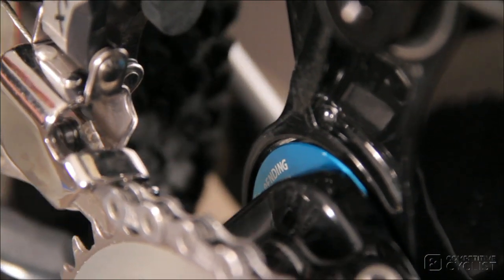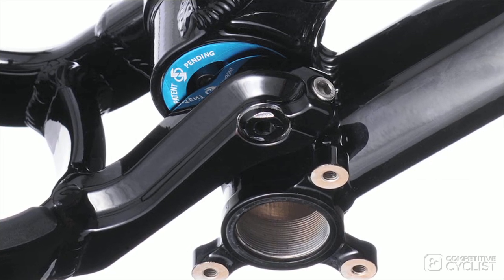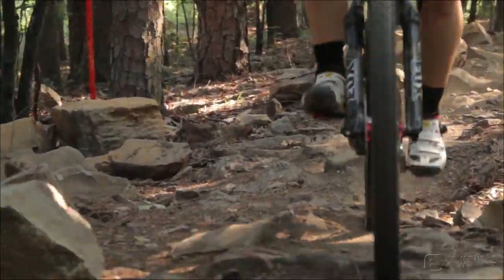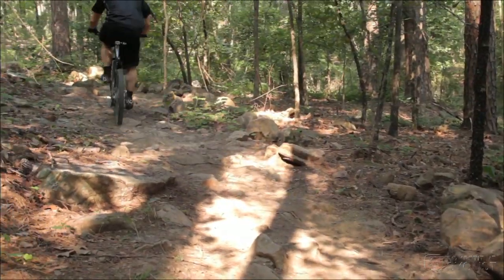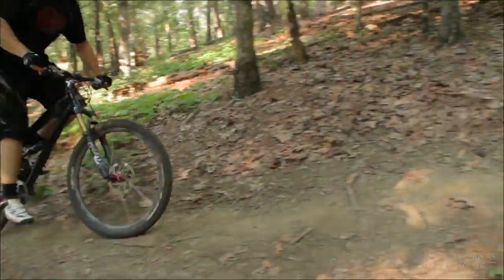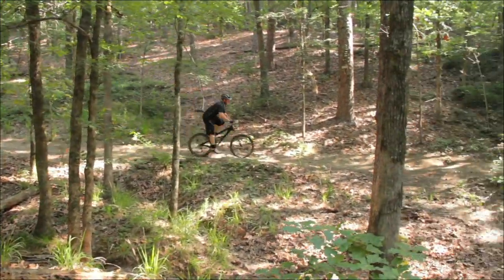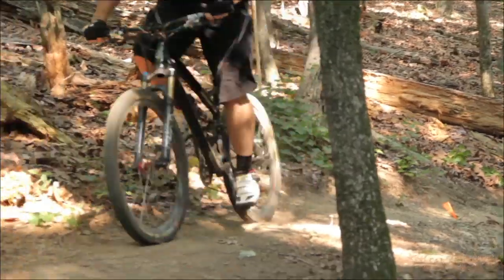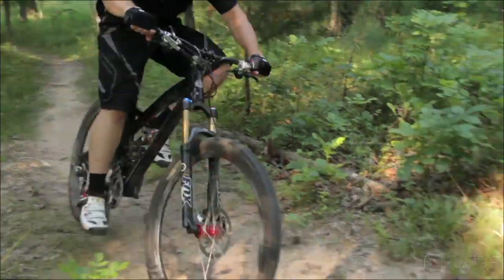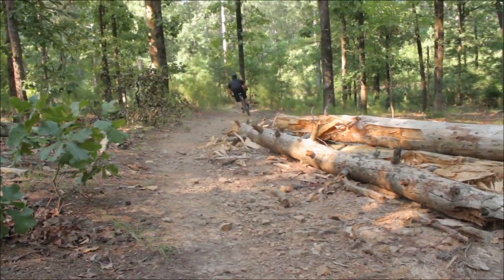While this happens, the rate of chainstay growth changes and affects the way the bike rides. The end result is a no-compromise trail bike that truly does it all. The SB66 pedals well on the flats, and it goes uphill like crazy. You can hammer down in the saddle and feel the suspension moving independently of your pedaling forces, reacting only to the bumps in the trail. When you stand to accelerate or stomp up the steepest pitches, it just goes forward. There's no wallow or up-and-down motion making you feel like the bike is robbing you of your power. There's an element of anti-squat built into the rear suspension that counteracts your body's movements.